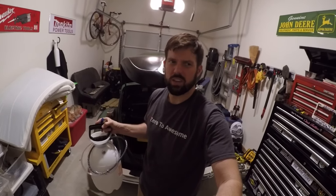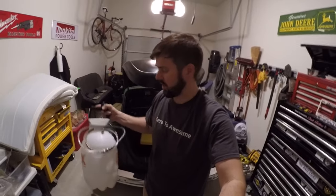So just run your pump until you don't see any bubbles, fresh fluid coming out, and Bob's your uncle. Actually, Bob's not my uncle, but there you have it, the homemade brake bleeder recipe. Now I just have to do the other three wheels and put the pedal back in and clean up the huge puddle of brake fluid that is leaking all over my garage.